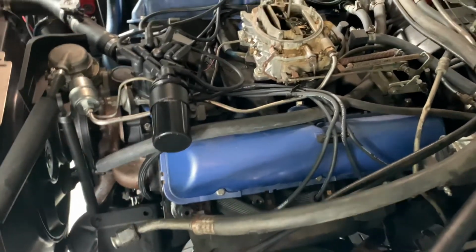But one of the hardest parts, something that I didn't expect, was just the boots, man. They were a pain. They're so tight on there. It's just the more little bit of oil that I used on my fingers, I had a little quart of oil, and I would dump it over and get some on my fingers and put it on the plug wires. And I know some people might say that's not a good thing to do because you're going to have spark on it. I cleaned every speck of oil off of it. I mean, it wasn't a whole lot. But if you have something else that's a spray lube, preferably non-flammable, don't get me wrong. But if you use something like what I used, make sure you clean all of it off.